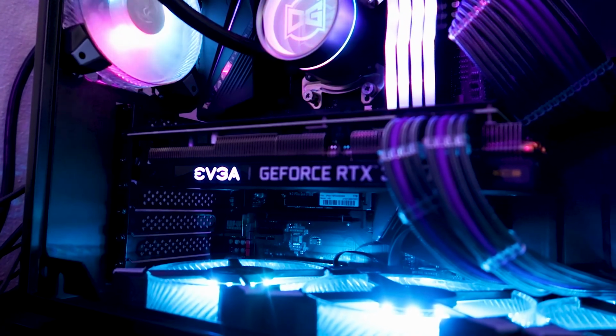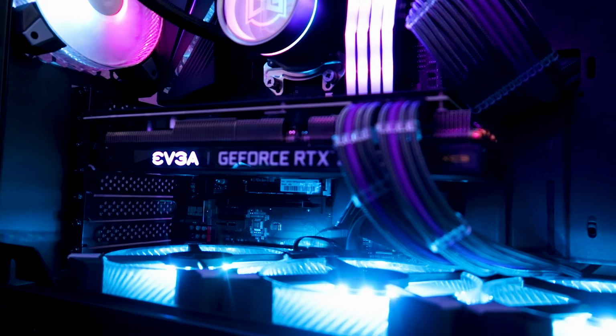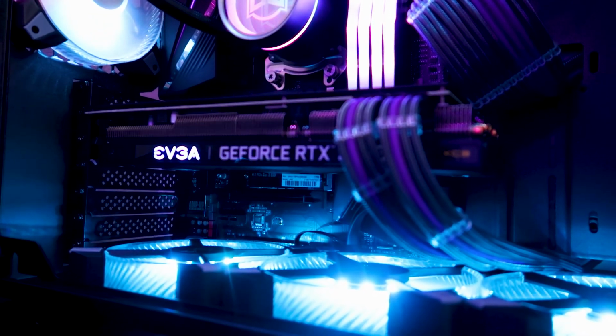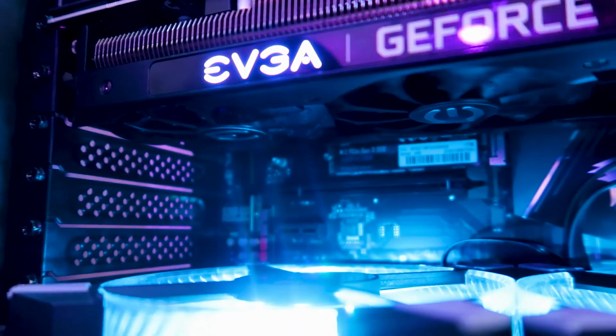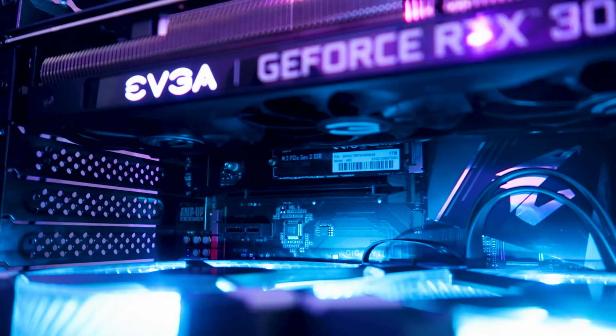Now, for some people, that's no big deal. It makes it a little bit harder to get towards your bottom USB 3, bottom USB 2. For this case, you have to use USB 2 for the little Glow software, and I think we might touch on that in a little bit. But basically, it will kind of block off where you can't put an add-in card, say a capture card or whatever you may be using, in that bottom PCIe slot.